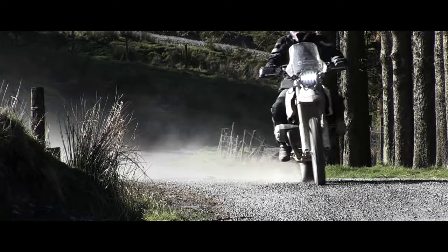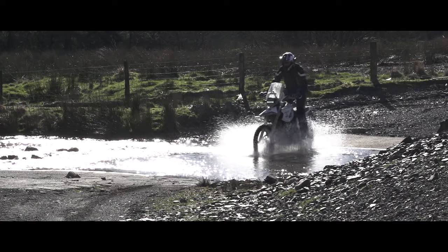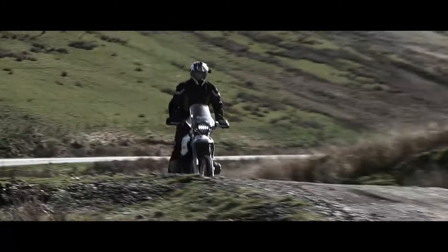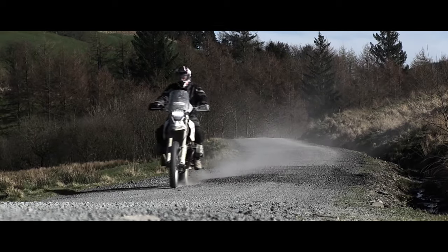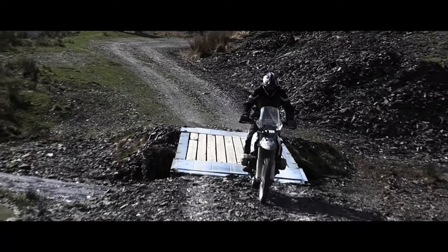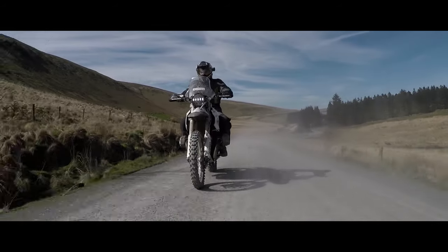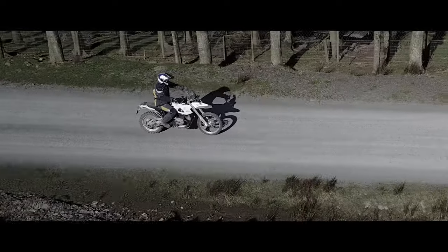This is no GS with a few flash bolt-ons and carbon fiber bits to save weight. The Telelever front suspension is gone, replaced by conventional WP upside-down telescopic forks with more travel than the Telelever could provide. There's adjustable compression and rebound damping. The rear uses an air shock with no spring or oil, delivering 9.8 inches of travel. The setup and adjustment is simple — take a look at the onboard ride height checker and adjust the rear shock using the onboard hand pump. Weight is down to well below 200 kilos and power is up 5 horsepower over the 2005 GS 1200. They even save weight by removing the balancing shaft, which can make it a trifle vibey. It's a full arms and legs upgrade, followed by an Atkins-level weight loss regime and a strengthened heart to boot.